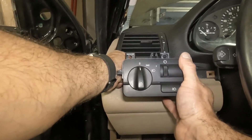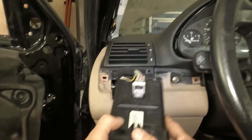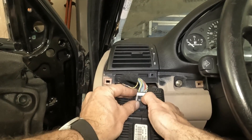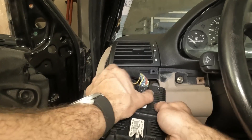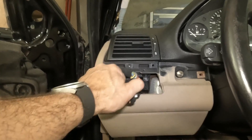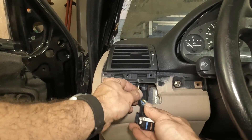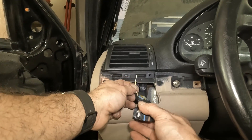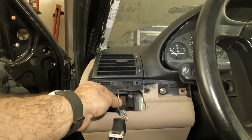There's a wiring connector on top — just pull that out all the way. You can see here's our connector. This is a press dial also — you press it down and slide it forward to disconnect it. And lo and behold, I have a pin providing poor contact, and that is the source of my problem. Yes, this is a bug I set up before I started — this is simulating a break in my wire.